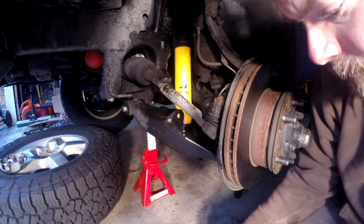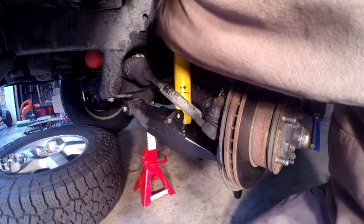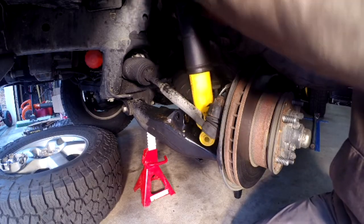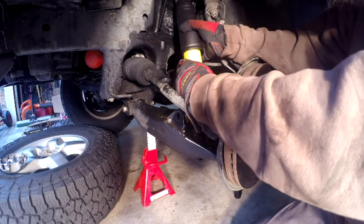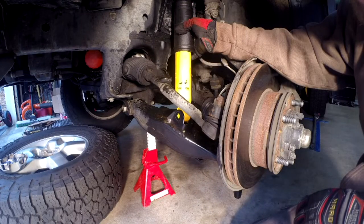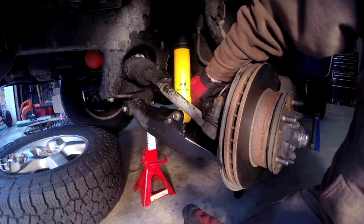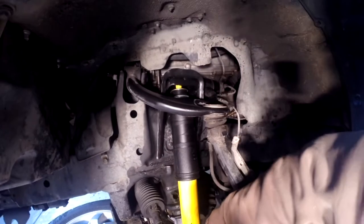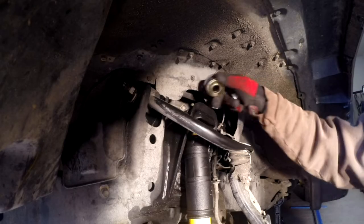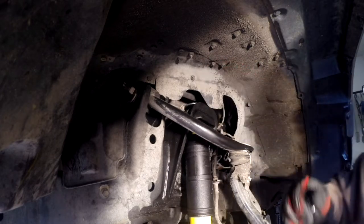So while it's expanding in position, forgot one thing. Gotta get the first bushing like this, so I can pre-compress. A little bit harder than the stock one to compress. Put this on. Silver washer down and the sort of gold zinc plated washer up. Since that kind of fits in the mounting tower there, I'll stick this bottom bolt back in. Get this nut on finger tight back here. See that sort of expanding up right now, so I'll be able to get the top nut on. Again, the zinc plated one's gonna go down into the tower with the silver one up top, and then I got my top nut here.